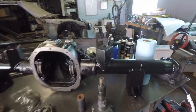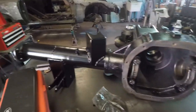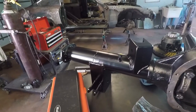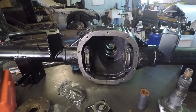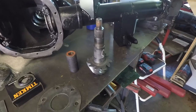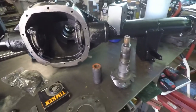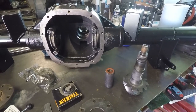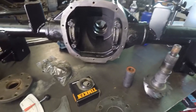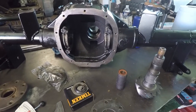Back on the Pontiac today. As you can see, I got it all cleaned up and painted, got the sealing surface all cleaned up, and I pulled the seals and bearings — axle bearings out — and checked the pinion bearing, and it didn't sound good. So I pulled it apart, and the inner race was toast; the race that goes in the housing was getting there. So I decided to replace those. Like everybody else, I watched a bunch of YouTube videos and bought a kit with Timken bearings, and also got new bearings for the outside, new shims — got the whole kit. So we are going to attempt this.